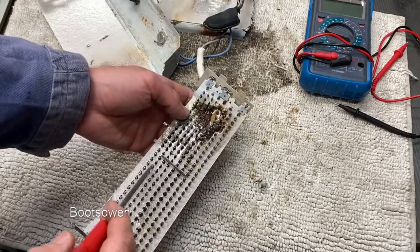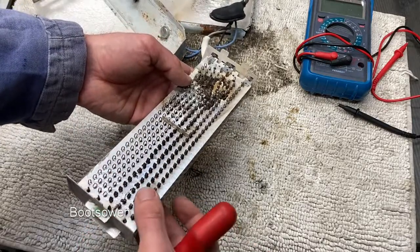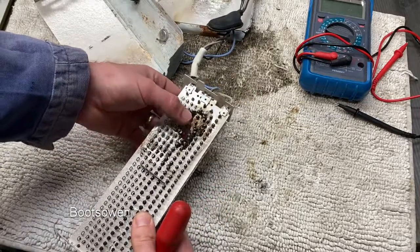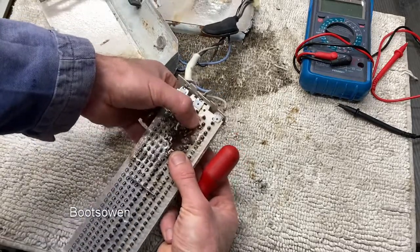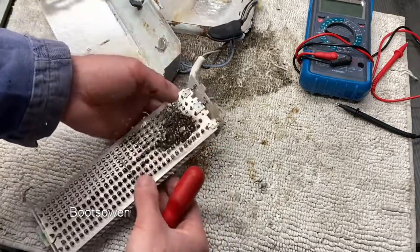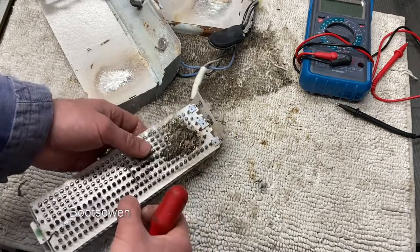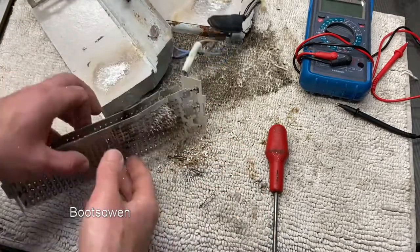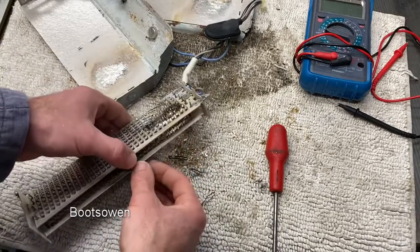You can see there's a high element up here on this side with fatter element wires, and the low element appears to be thinner wires. But that's broken, and that's the issue there. The power can't get through it to heat it up. That's probably what those scales that were in the machine were, bits of mica that had blown through. Yeah, that's completely knackered. I'd say a bit of wet stuff got in there and wet all the mica,